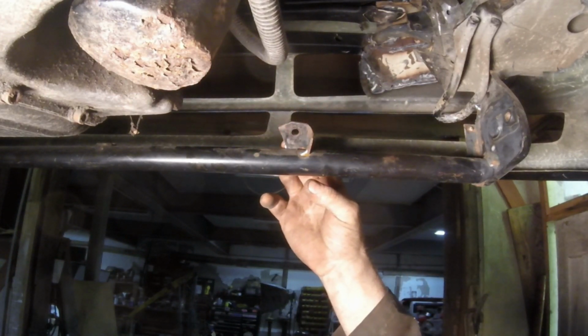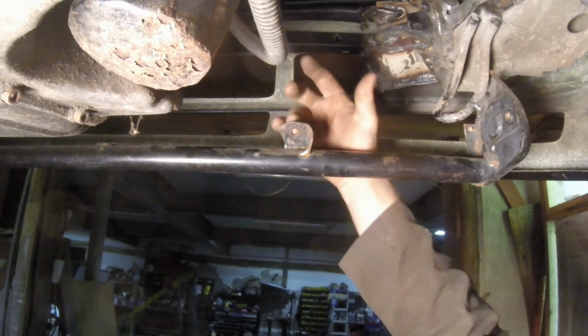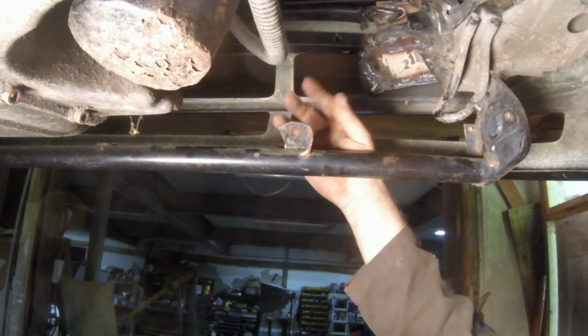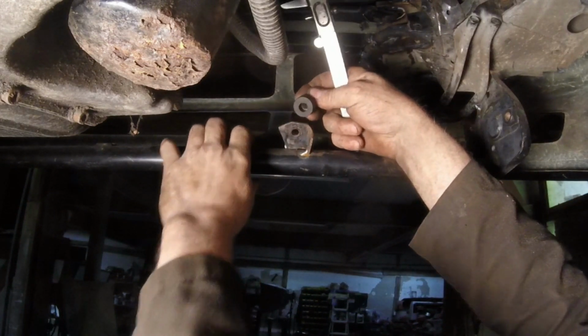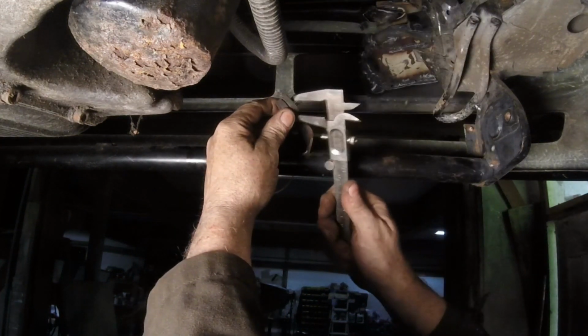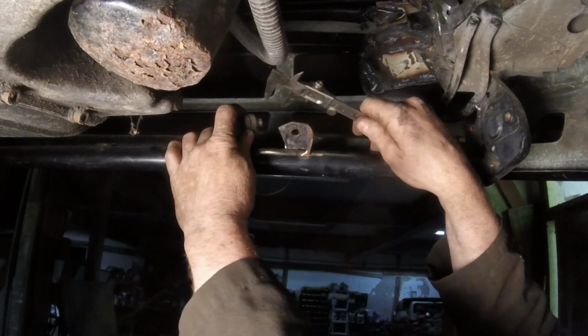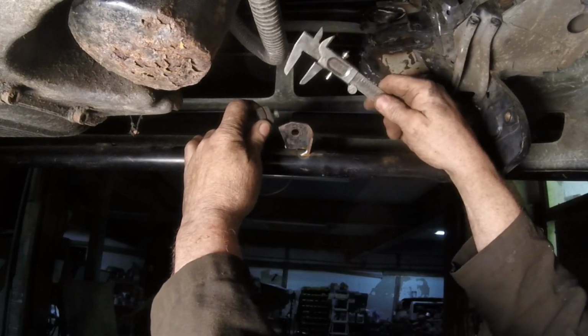I kind of broke my first rule. It's such a large piece of aluminum. I want to isolate the vibration from steel to aluminum because I don't want it to crack. What I'm going to do is use these. This is just another grommet, just like I used on the side of the intercooler, with a sleeve. I believe these things came off the vacuum pumps in the back of the Quattros. I can't remember, honestly.